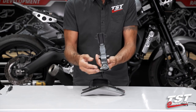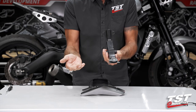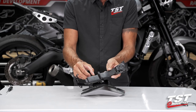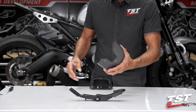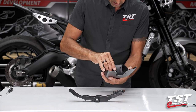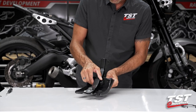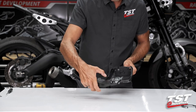Other bikes do have the key cylinder facing the ground and they don't have any shrouds. The choice is really yours. We will put a little hole here and do a little slice here — a couple of little things to make this actually fit with our new setup. When this is assembled, this whole setup is way too long. If you remember where we took this off from, that would interfere with this component here. So we are going to have to trim it and then put a mounting hole in here.